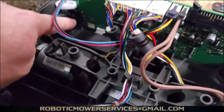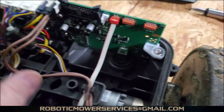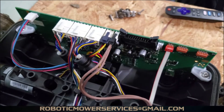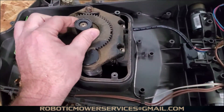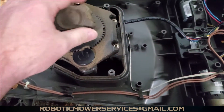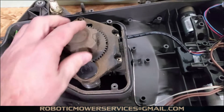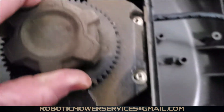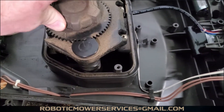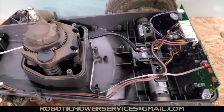They have the loop sensor up in the front, and they also have loop sensors in the back — those are these little black boxes in either corner of your motherboard. This big circuit board back here is your motherboard. This is your height-adjusting mechanism. With the knob on there it probably looks more familiar. There's a spring to keep tension on everything, and it's all mechanical on the 300 series.